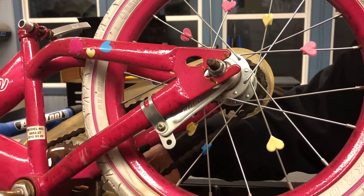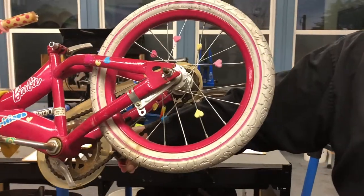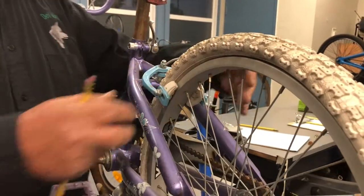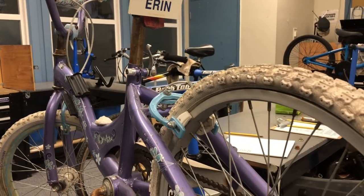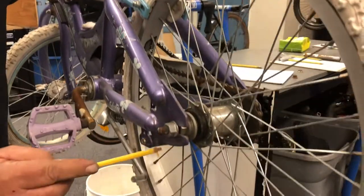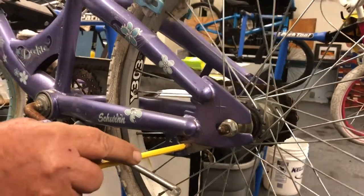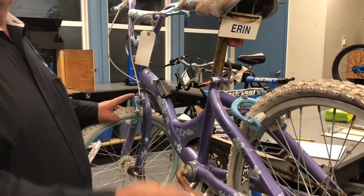This worked really well for a while, however it would wear your tire out and would cause skidding, and people were wiping out and getting hurt. The next type of braking system they came out with was a spring-loaded dual arm braking system using a brake lever mounted to the handlebars. You would pull on the handlebars pretty hard and it would squeeze the brake pads up against the rim to stop. Note they still had the pedal-backwards-to-stop, so this was just a dual braking system, and on this model they did the same braking system on the front, so there are actually three different ways to stop.